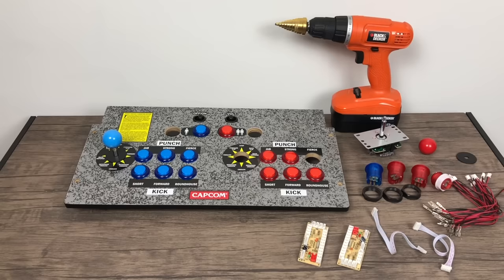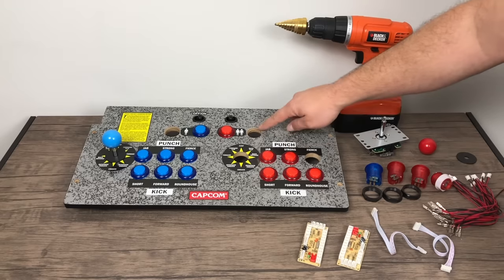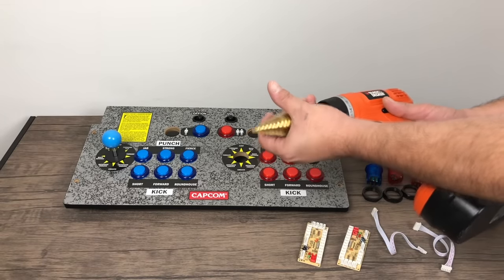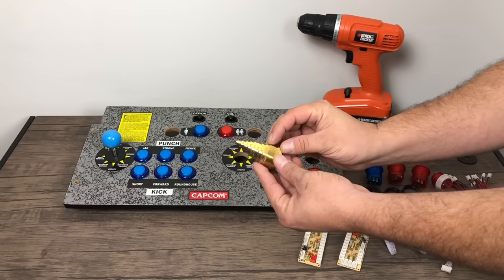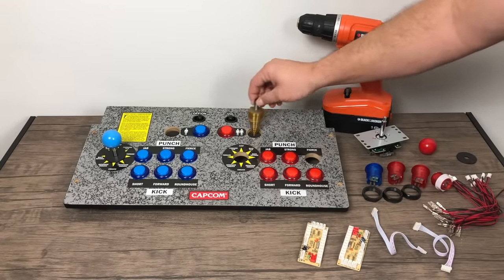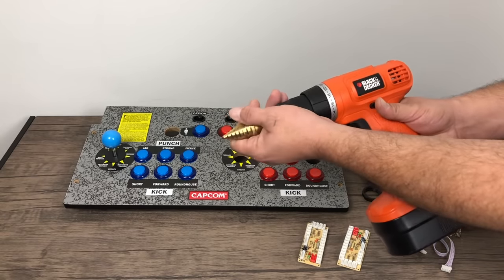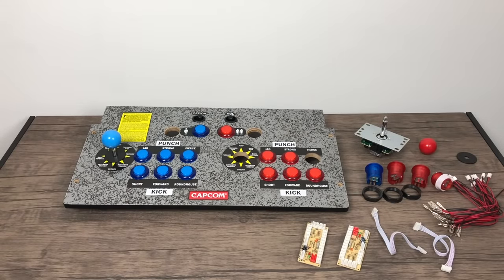Like I mentioned at the beginning, I was going to add two extra buttons to this control panel. I did that by drilling two 30 millimeter holes with a step bit. You can use a 30 millimeter hole saw or pick up a step bit from your local Lowe's. If you're afraid of damaging your control panel, you could drill a hole in the cabinet itself or use a smaller 24 millimeter button. The main reason I added two extra buttons was for a select for player one and a select for player two — with RetroPie it's good to have those extra buttons, and we can set them as hotkeys.